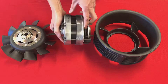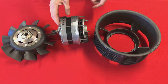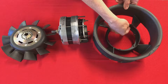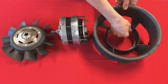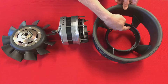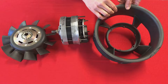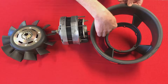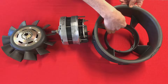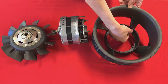In order to get the higher amperage they had to make the alternators longer. So you'll find that the depth of the machining in the fan housing changes over the years — there are three different depths. This is actually a later 3.2 fan housing, the deepest one, to accept the longest alternator which is the 90 amp type. This fan housing is also the most fragile because it has the most material machined away. The earlier ones have quite a thickness which makes them stronger.